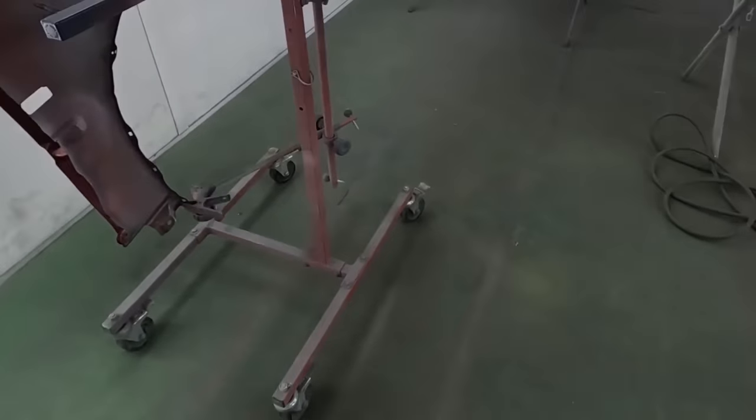And getting that ground coat on, I'm starting on my side, then Mario picks it up on his side. By no means necessary, though, do you ever need two painters to paint a car, but this is a collaboration, and it really did help keep that wet edge. And what is that wet edge, basically? Well, at the edge of your pattern, it's going to be wet. Like in the middle of the hood here, it's starting to have that wet edge. And if I have to jump around somewhere else, that edge is going to dry. So by having this little bit of extra help, our wet edges will connect here in the middle of the hood, and we won't have to worry about any dry edge.